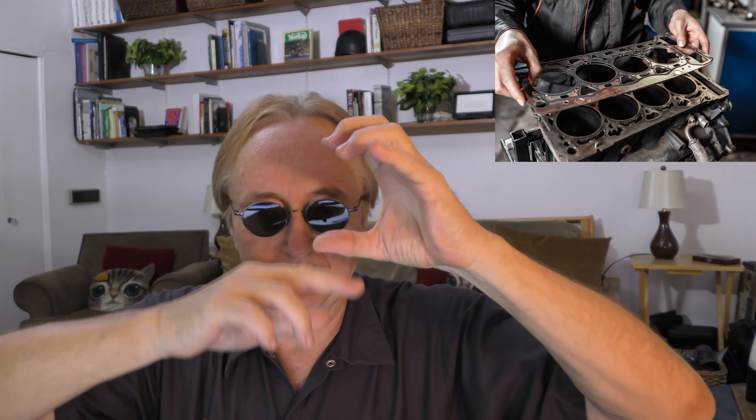The intake manifold gasket — no, if it's leaking you replace it. Now a head gasket, yes, that's a completely different gasket. The head gasket is between the head where the valves and cams are and the block of the engine — all that pressure is in there. If the head gasket blows and you put a new one in, that strains the valve seals and the piston rings because it's sealing better now. That's why if you're going to rebuild an engine, you rebuild the whole engine or just give up and get another car. You do a partial rebuild on an engine with a lot of mileage and the head gasket blows — odds are there's other worn parts. Rebuilding engines is an art, a lot of skill and a lot of money. Most people don't want to spend the money, and a lot of mechanics don't have the skills, so it's not smart to rebuild them much anymore. But an intake manifold gasket? No, that isn't going to hurt anything. That guy's a horrible mechanic — don't go back to him.